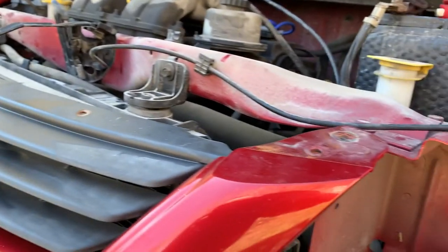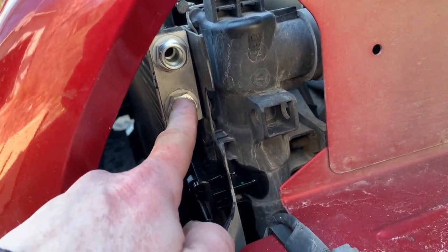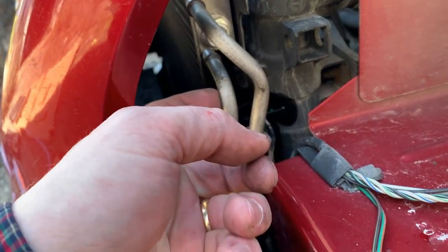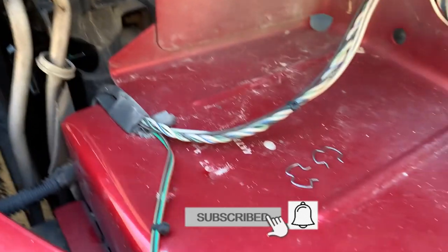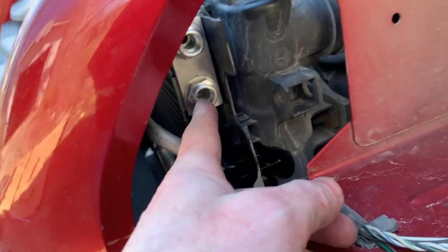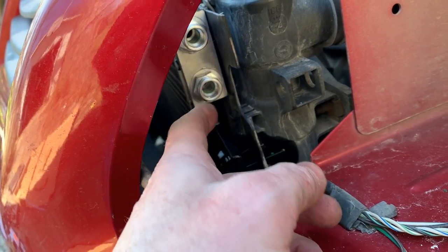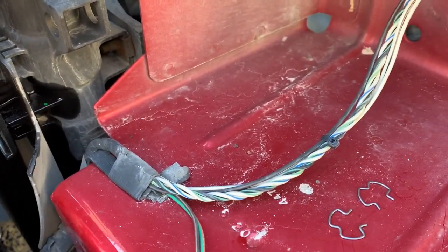What I found was easier: take the headlight out and put these studs in first all the way, then snap your pipes in. You've got little snap rings here to clip back in to hold it in place. I cannot get those snap rings in there by themselves with the pipes already attached, so I had to detach them — put them in first, get them tightened down, then run your pipe in and put your clips in. Taking the headlight out makes access a lot easier.